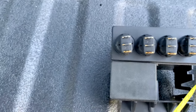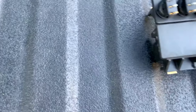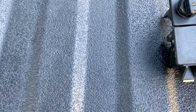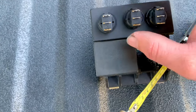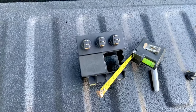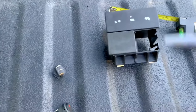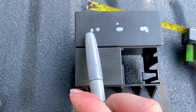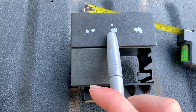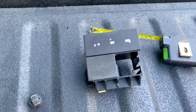I thought I could do four, but as you guys can see I cannot because they're overlapping just being this close. So if I ever wanted to run the reverse lights into a switch I'm going to have to do it somewhere else. We're looking at having everything centered pretty good — something like this. I'm using a step bit — I just want to drill out and keep testing to make sure it fits. This might be a little hard to follow because there's a couple marks, but I marked, measured, marked, and measured. I'm using a Sharpie because this is black and pencil isn't going to show up. This mark right here is where the first one is going, the center right here is where we centered it, and this one where I dropped the line down is where the third one is going. This is a step bit so it's going to cover any of those marks. Let's get into drilling this out.